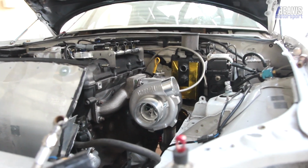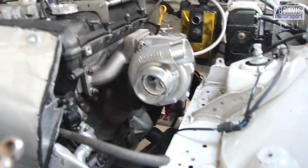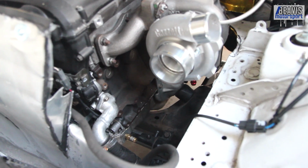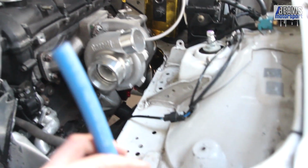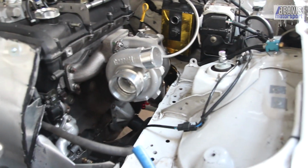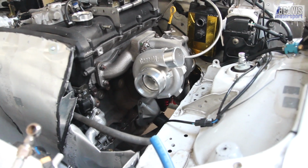They're sitting here now. Took the 2 coolant lines off, and I was able to get a short 12mm spanner in under there. We now need to hook that barb fitting up to the barb in the sump down the bottom there. So I've got some of my trusty blue oil hose that'll fit perfectly between those 2. We'll just run that now.